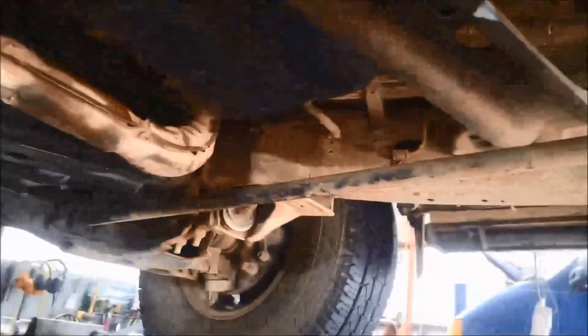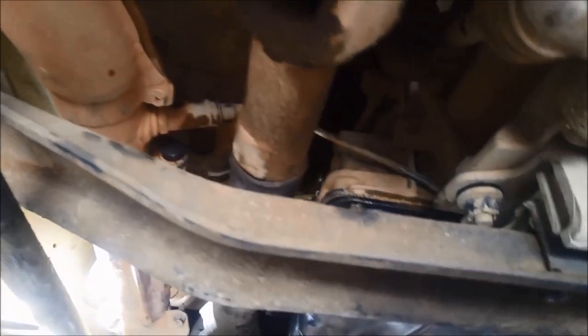Exhaust back on — I haven't tightened this up until we put the crossmember on yet, just so it's all nice and even. When you're putting the crossmember on, just leave these two loose because sometimes it'll pull forward or back and you won't line up these bolt holes there on the crossmember. Then we can tighten up these two on the exhaust.